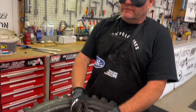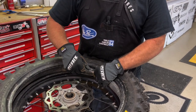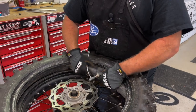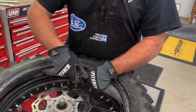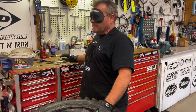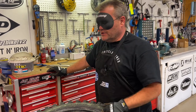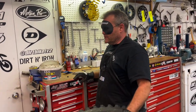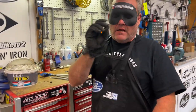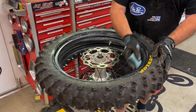Tire tool. I want to let a little air out of the tube for install — it's a little too much. It's a good Dunlop tube. And this valve stem tool — before I forget, we've got to have a commercial. Email me about the tire stand if you want the drawings to make your own with your uncle, brother, welder, buddy. Also click on our Rocky Mountain link in the description for parts — it helps us out. Tire paste — we use ProBuds, that link is in our tire stand drawings email. I want to get the paste on the tube and on the inside of the tire, on both sides.